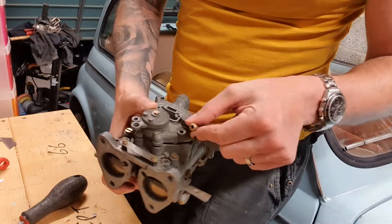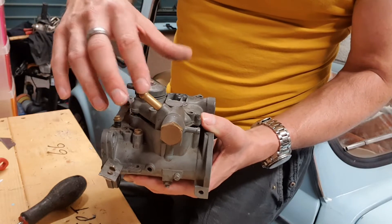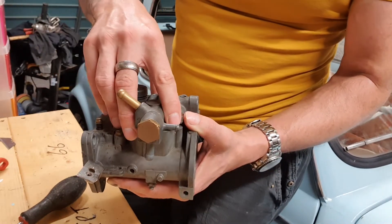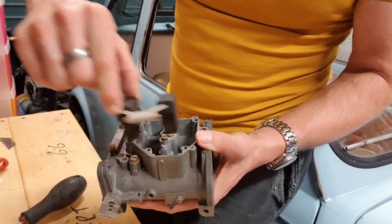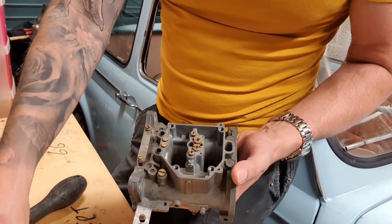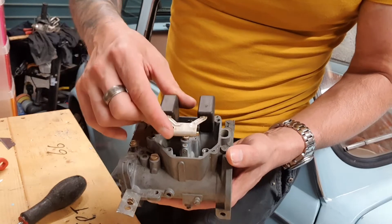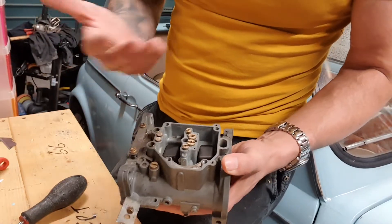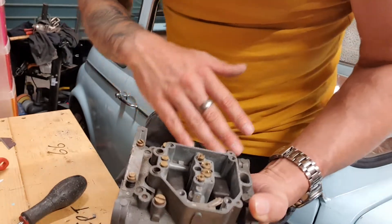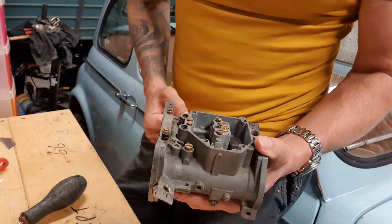So what are the main parts making it up? First of all, you will have a fuel inlet — in this particular case the fuel inlet is up here, though this position could vary. I'm just going to take the top off here to see where the fuel goes as it's pumped in by your fuel pump, either your mechanical or electronic fuel pump. It goes into what is known as a float chamber. In this particular case we have a float chamber here, and it's called a float chamber because in it is a float. This particular design has two plastic floats — often they will be single brass — and they sit in there. The purpose of that float is to control the fuel level in the fuel bowl inside the float chamber, because what you want is a consistent level in there so that the carburetor always has enough fuel to draw from in order to fuel your engine.